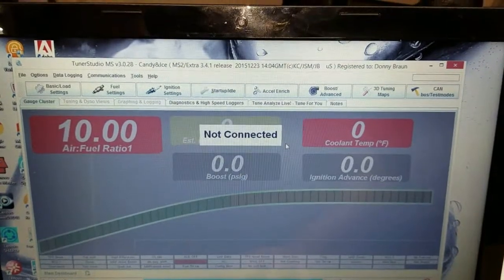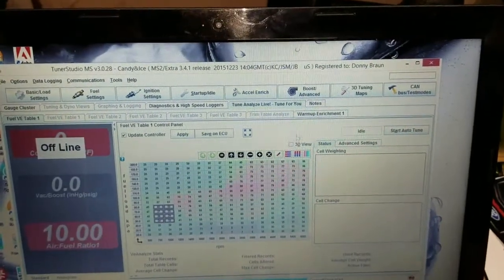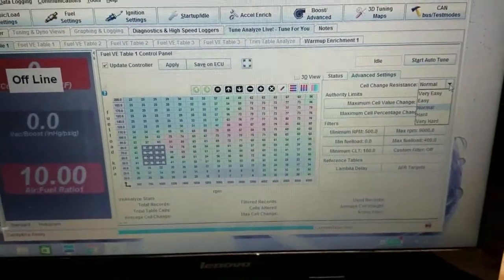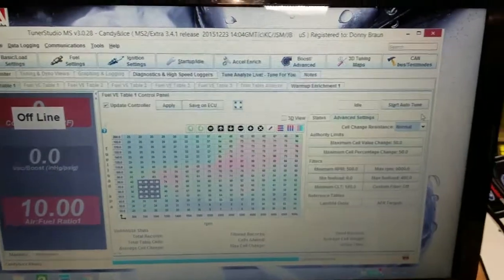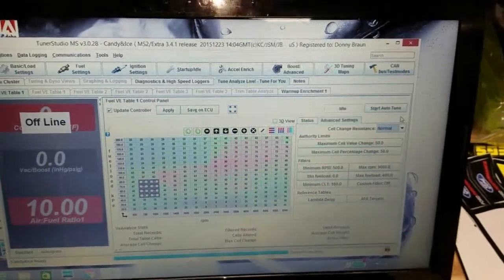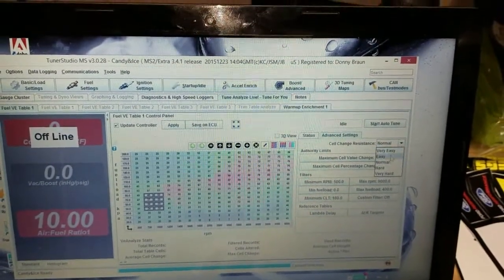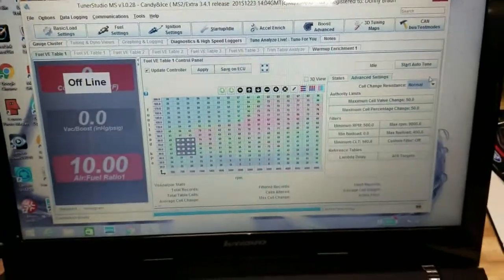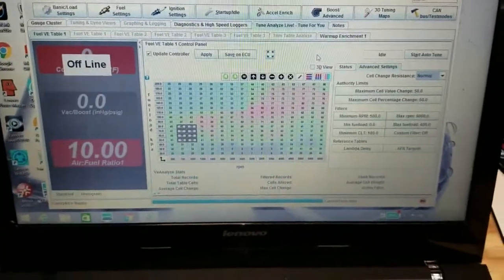Pretty soon I'll take you guys out for a little spin so you'll see how the autotune works. You can go into advanced settings and for your initial first couple drives, you'll want to switch this to easy because it will make the most drastic changes. So if you're running extremely lean or extremely rich, it will pull the most fuel out or add the most fuel in those cells. Once you drive around for probably a good half hour it will be locked in pretty well. Then you can start autotune again, switch it to normal, and it will make very minimal changes. You'll want to do this autotuning for quite a while, for a few days, because you want it to gather as much data as possible so your car runs good.